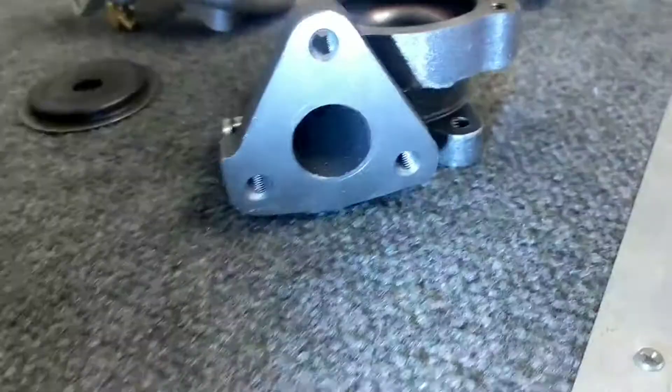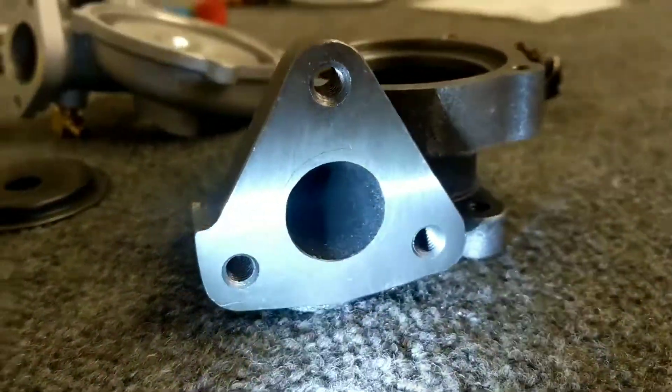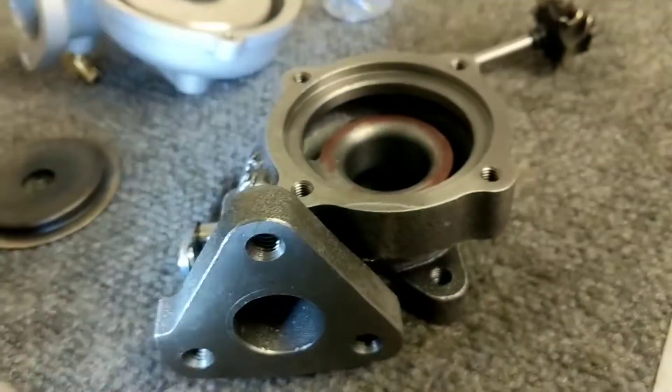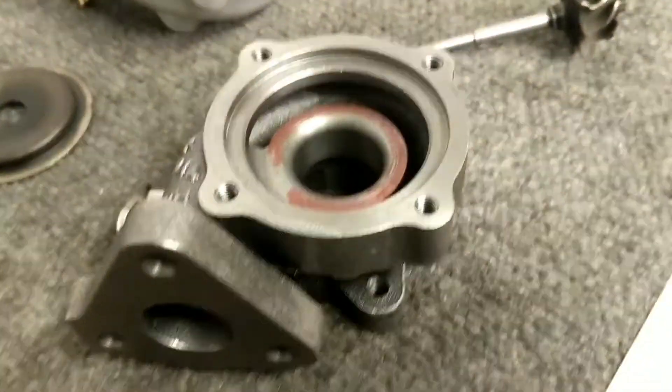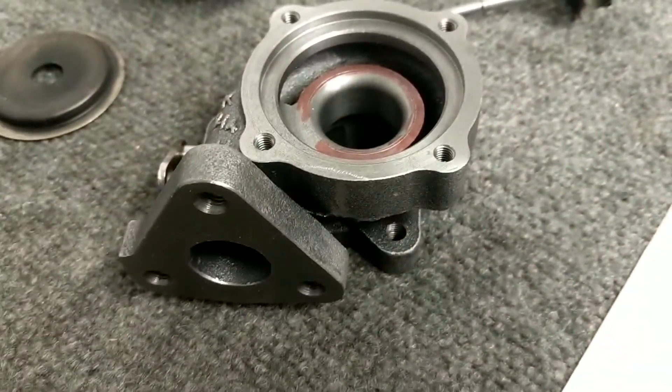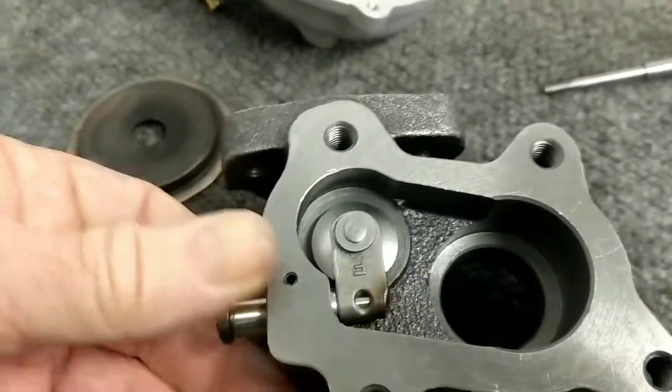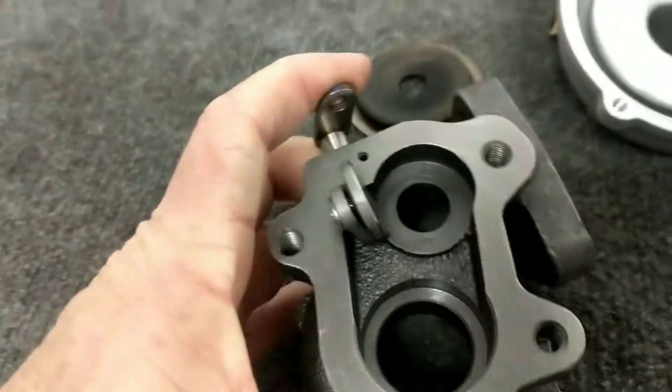Let me see inside the thing here. I ground a lot of the stuff out inside it to sort of reduce back pressure. It's still going to make 19 pounds of boost. But what I found was that with the wastegate wide open, it would still overboost.